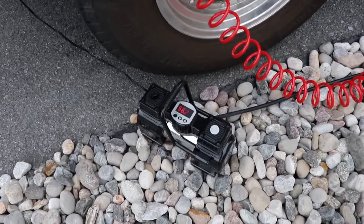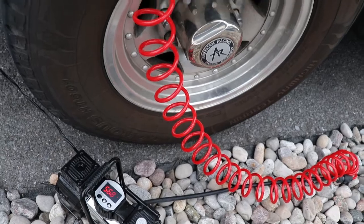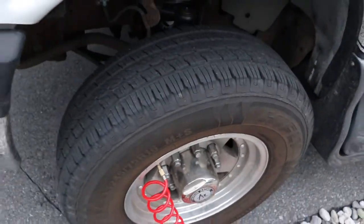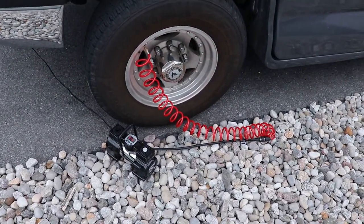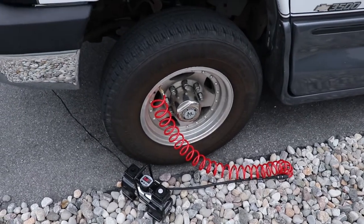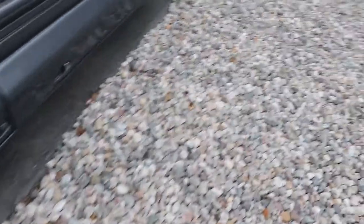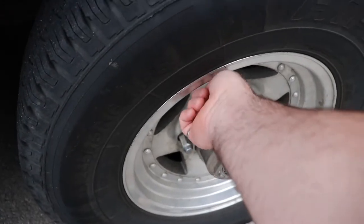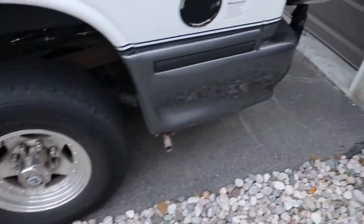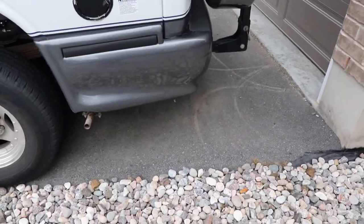So this one was down to 50, which is about right. But I'm getting a bit of cupping on the outside of the tires and a bit of front end wobble. So with the lift on this van I just wanted to try at the higher pressure — it's not the lift's fault that it's doing this, but it's made it a little bit more obvious. And to get from there around and then flip this tire down like a beaver tail, you'd be another six feet, and I don't think that's going to reach it.